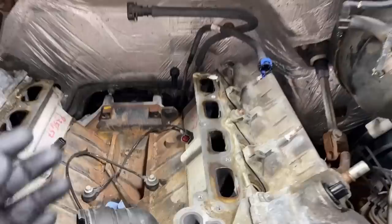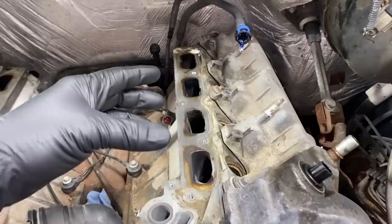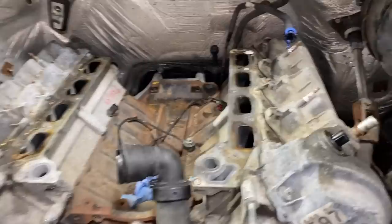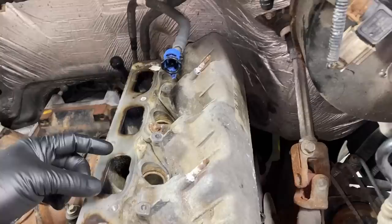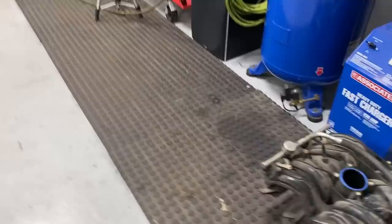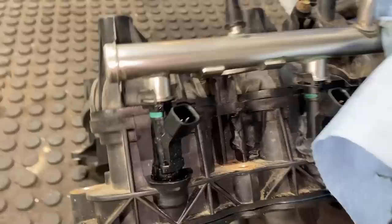I started looking a little further and I heard a vacuum leak sucking sound right in the intake runner for number six, which is really weird. I've never seen the intakes on the 5.4 3-valve crack - ever. It could be from the brake booster hose back here that likes to come off, but no, it was definitely right here at number six. So I busted the smoke tester out, smoked the intake, and it just came rolling off from underneath here. There was a little hole in the side of the intake poofing out smoke. I didn't think it was cracked - I've never seen one cracked since 2004 when they first came out. I think it's melted.